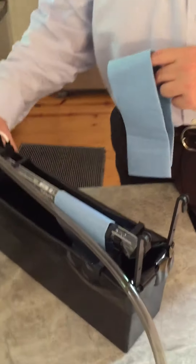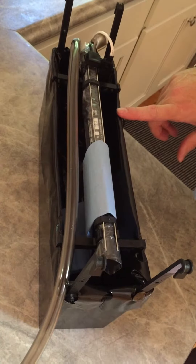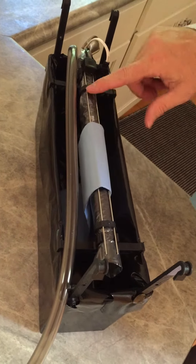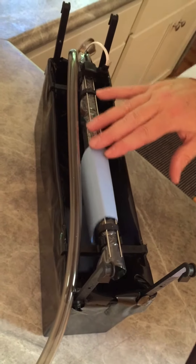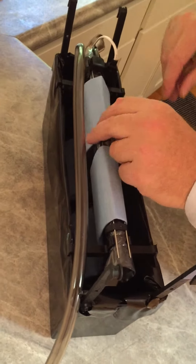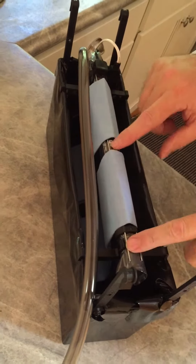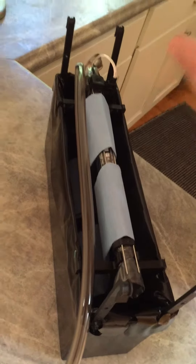This is the humidification system. All it does to humidify is use a little 50-watt heater bar. When these wicks are hung over it into the water, the wicks pull the water up, and when this turns on, it evaporates the water off the wicks.